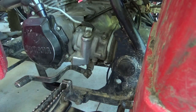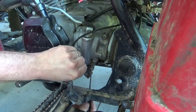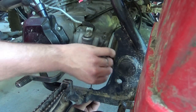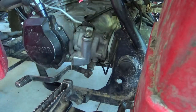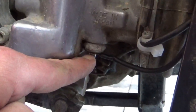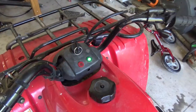This looks good — let's get a screwdriver, it's kind of a weird angle. Here we go. Just so you can get a better view: this is that connection right there for the reverse light, and that one right there is for your neutral light. So both of those were torn out. Now when we turn it on — I have it in gear, put it in reverse, reverse light comes on. Put it in neutral, neutral light comes on.